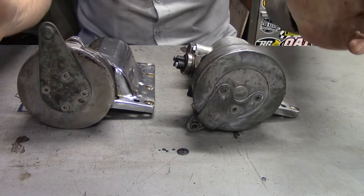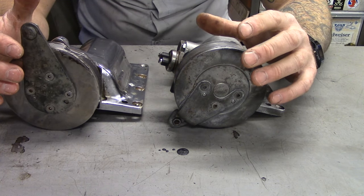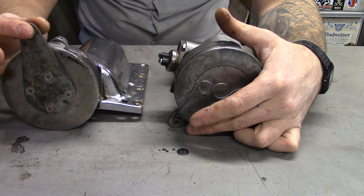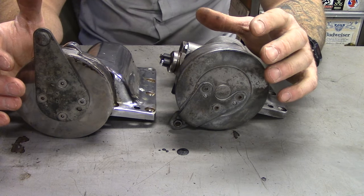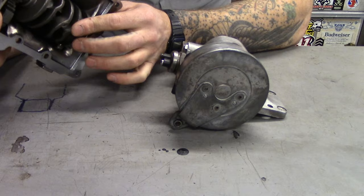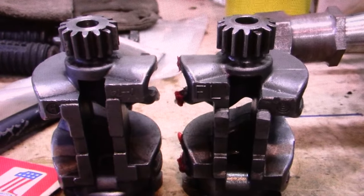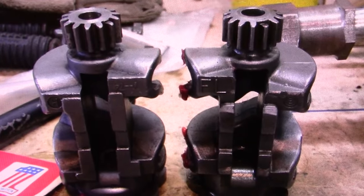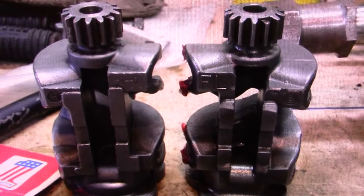The main difference between an FL and an FX style shift drum: most notably you can see on the FL the shifter linkage attaches at the bottom, and on the FX the shifter linkage attaches at the top. That's probably the easiest way to spot them, but you can't always go by that. There were a couple of models in the early 70s that had the FX style lid but with an FL shift drum. A quick search on Google yielded an excellent photo comparing an FX and FL shift drum. If you look at them, the FX drum on the left and the FL drum on the right are virtually mirror images of each other.